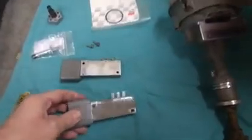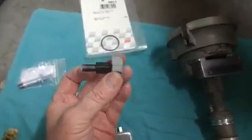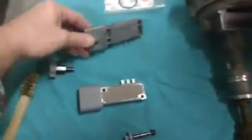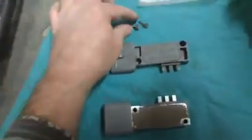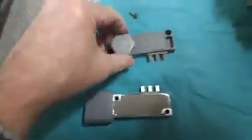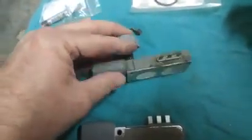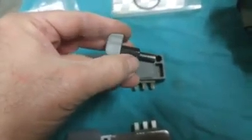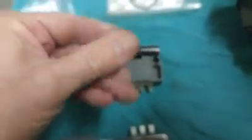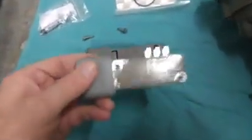The last trick — let me show you this first. This is the TFI module wrench. If you're unfamiliar with it, when you go to take these tiny little bolts out, the only way you're going to sneak in there is with a really thin-shaft tool. This module wrench tool is made just for that, and it's also got some half-inch wrench flats on it so you can put some leverage on the tool to turn it — because you can't turn it by hand hard enough to pop the module bolts loose unless they've been recently loosened. That little ten-dollar tool is worth its weight in gold.